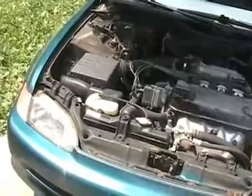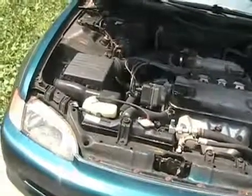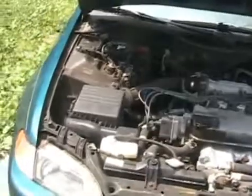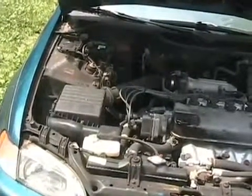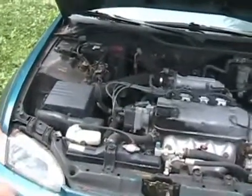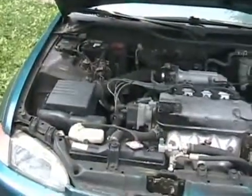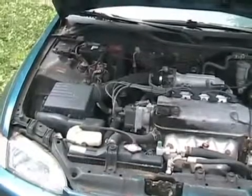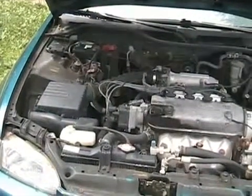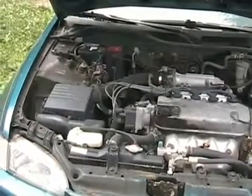Yes, when you have an exposed air cleaner like a K&N and not one of those plastic boxes, you get to hear that engine wah sound, or sort of a sucking sound too, which some people like. So the theory is true. If you have a long, smooth, shiny metal pipe, yes, there's less aerodynamic drag inside of there when the engine's running at high RPMs, so you will get slightly more airflow.